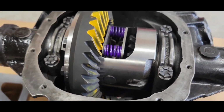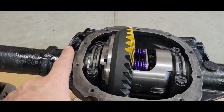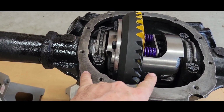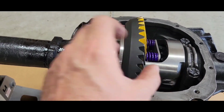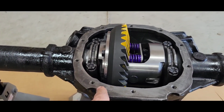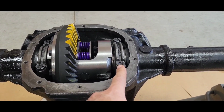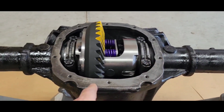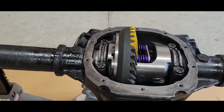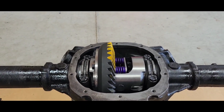That's actually pretty good. So, what I'm going to do now, take it back apart and make them solid shims tonight. I could probably run with those, but I just don't like any mushiness, especially when I got more than a couple thin ones in there. I only got one thin one over here, and then the stock one, 25 thousandths shim. And yeah, I don't know. Probably gonna make new shims is what I'm thinking.